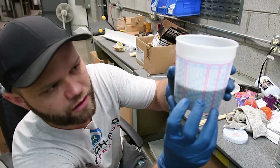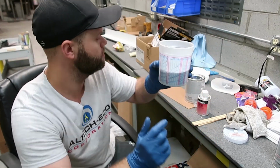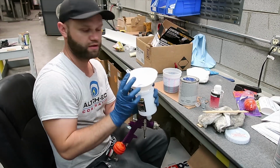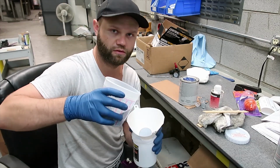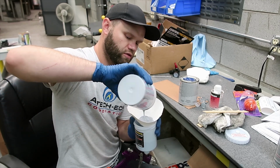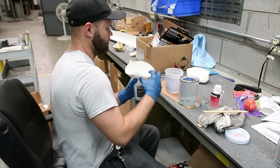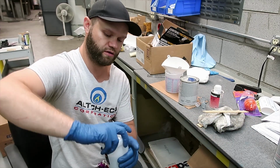So if you can see here, I poured primer to 3 and activator to 3 on this mark right here. So 4:1 ratio. Now let's mix it. I'm gonna use a special filter, pour it in here. Yeah, let's do this. Prevent any dirt or anything getting in there, so I'm just gonna do that. Excellent. Put this here. Close it with the lid.